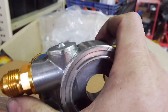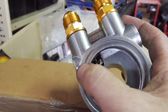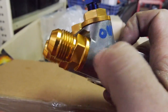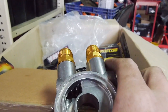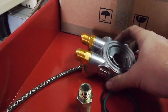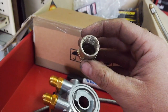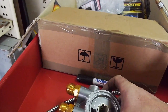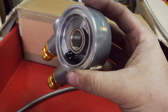It is a thermostatic one, so you can see there's a thermostat in there. That spring opens up and then oil comes out this port here. This style doesn't screw on — it has a sleeve that comes through it, which suits the Subaru M20 oil filter thread. It pretty much just sits straight through there, then you screw that on and it sandwiches on — hence being called a sandwich plate.